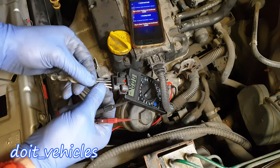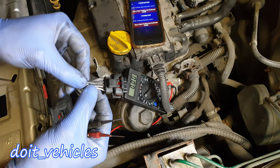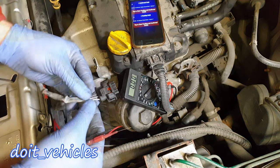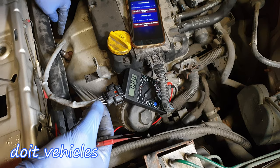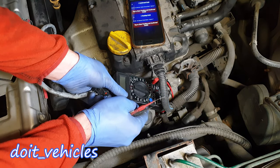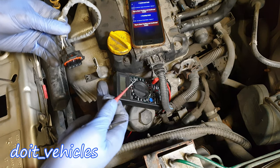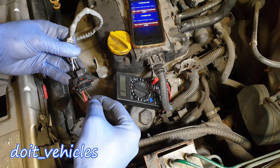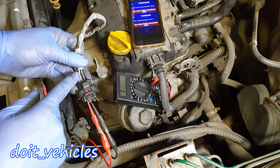On the sensor you will find 4 wires. On the oxygen sensor connector, identify the 2 wires which are identical in color — usually those 2 are for the heater, and in this situation they are white, though sometimes you can find them black or red. I'm going to test these 2 wires first. For that I will set up the voltmeter on ohms and go with 2000 ohms, because the resistance is usually between 5 and 10 ohms.